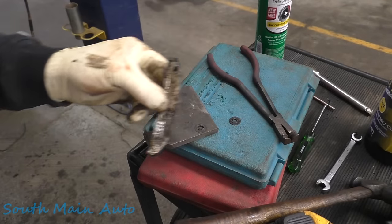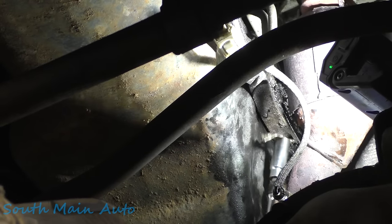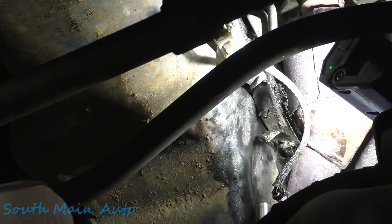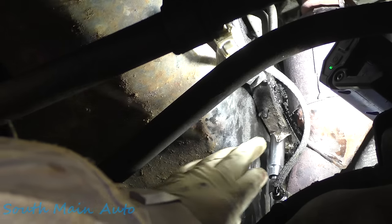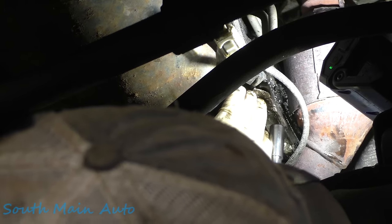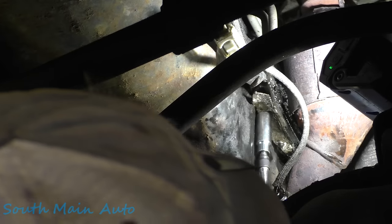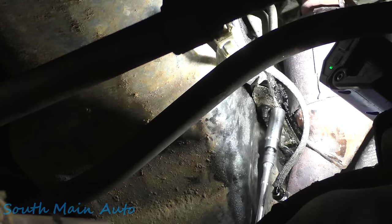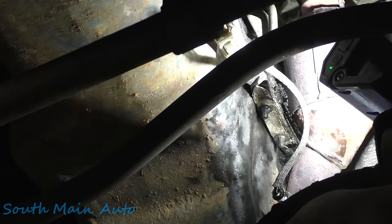So let me stick this back up on those studs. I don't know if we're gonna get that piece of foil back on there. We'll try. I'll stick the little retainer ring on the end of a socket, see if I can just hold that foil over there. Line that little guy up and then just give it a push. And that'll keep that on there like that. And then we'll take the other one here, just using a 12 millimeter socket. Might have to get a shorty to get to this back one. There we go. So stick that back on. That'll keep that wire up against the oil pan and, you know, a little heat insulator. I don't know how well it works, it's soaked through oil, but as long as it keeps them from burning up on the cats there, that's all you're looking for.